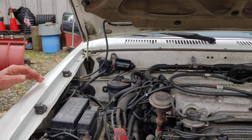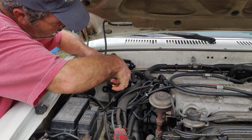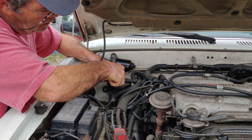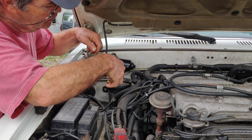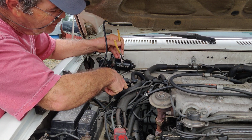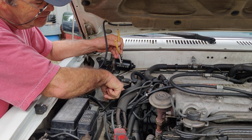The first thing I have to do is pull this canister off here — it's in the way. I had to buy fittings to convert it because the R134a hookup is different than the R12. Everything's in the way over here, and I've got to move this line over so the fitting is facing this way more. It's like underneath the high-side pressure.